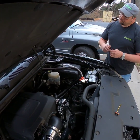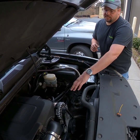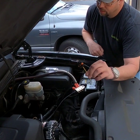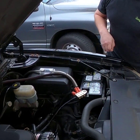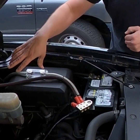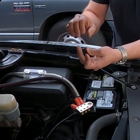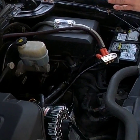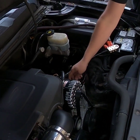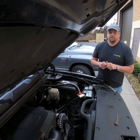On your '05 and up, you're going to have that RVC system, and when you bypass it you're going to get an alternator that has a 4-pin plug like this one here with the yellow. This here is a 12-volt switch source, and you'll have your remaining harness from the vehicle — not used at all. As you can see, it just dead-heads right here; there's nothing that plugs in here. It plugs into your harness and then it's done — you just tuck it away. Mine is tucked in right here; I just zip tied it to a current wiring harness. Looks factory. No one ever knows it. If you ever need it, it's right there.